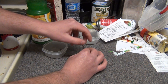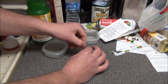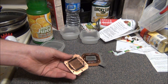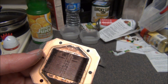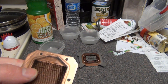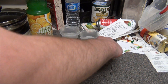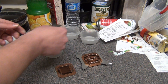My fiancée is probably not going to like me using all this lemon juice, but it's all for water cooling. This is oxidation right here and this is completely normal. Don't say 'oh your block's messed up' — this is completely normal when it comes to water cooling. You are going to get some type of oxidation. Go ahead and remove the jet plate — I'm going to put that in some lemon juice.